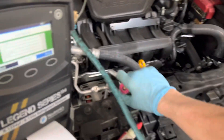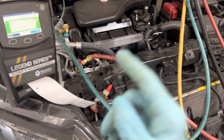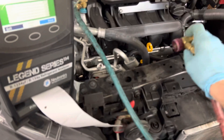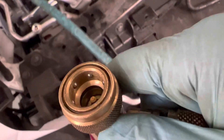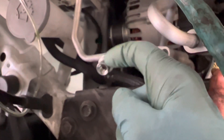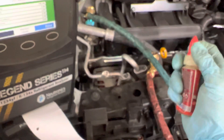We're not going to recover out of the high side first — because you do not want to recover liquid refrigerant, as you will remove oil out of the system. Sometimes you can damage the fine O-ring seals inside the fittings. This straight area is where the O-ring slides on — if it's rough, damaged, has dirt on it, or has oxidized, it will damage your O-ring inside, causing leaks and preventing you from pulling a good vacuum.